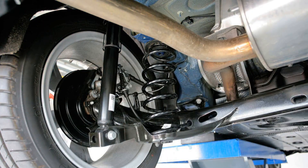If we talk about what a silent block is in any car, it can be characterized as an intermediary between the suspension element and the rigid body. Suspension elements include levers, leaf springs, subframes, and shock absorbers. It is quite easy to understand how this silent block works if you use the visualization method. Simply imagine that another metal element has been attached to the body — during driving, there will be constant contact between the two metal surfaces. Now make a spacer between the metal in the form of elastic material. At once, extraneous sounds disappear and comfort when traveling increases. This means silent blocks reduce the vibrations of the suspension. On some cars, silents can also be found on the motor and various moving elements, where they dampen vibrations and connect different parts to each other.